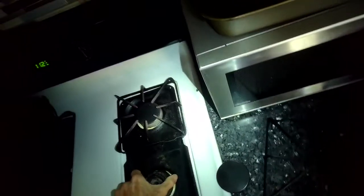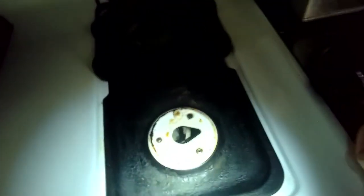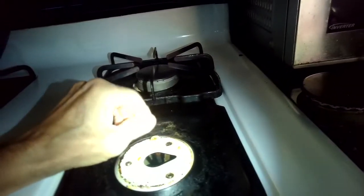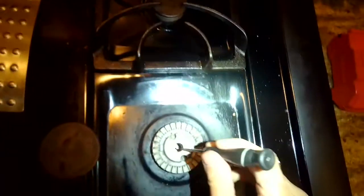That'll create a really good electrical connection and cause a much stronger spark. It's a pretty common problem where the burners get clogged up from boil-over conditions — usually we see this on the front burners since they get used most often, like when a bunch of milk boils over and clogs everything up. You can get wire brushes at the dollar store or on Amazon really cheap. You can also use a Q-tip with some rubbing alcohol to clean everything.